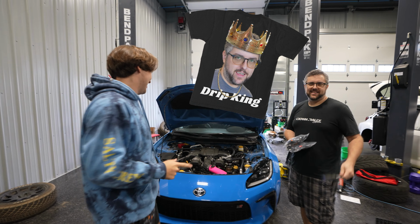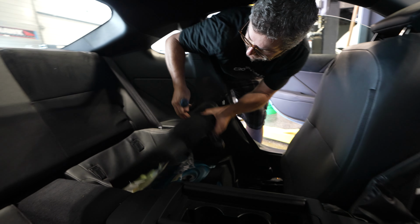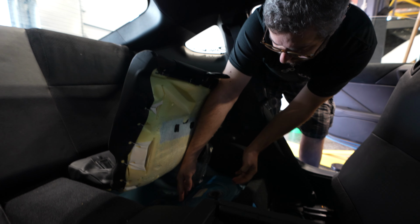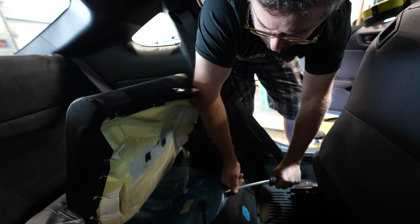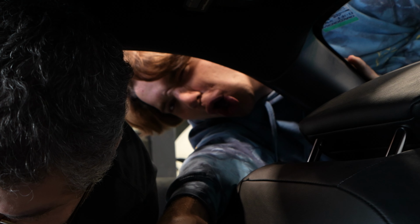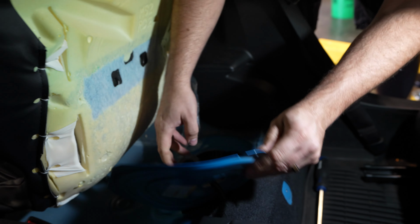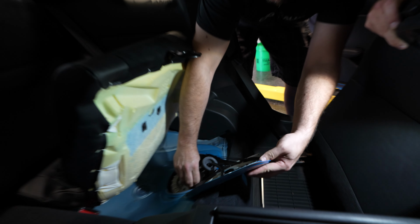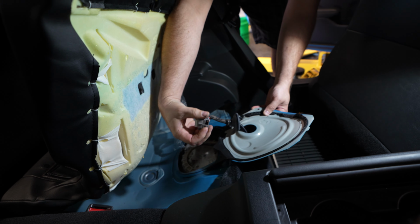First step, there's one bolt here. It's already going. Take this thing out. Toyota has this fetish with gluing the fuel pump hanger cover on. I don't know why. I'm just gonna pry that right up. They like glue. Pick your favorite hammer. Try not to distort it too much. So we just need to disconnect this. All right. Just one wire to the fuel pump assembly.